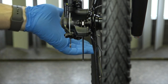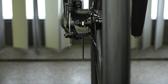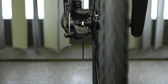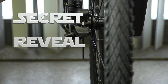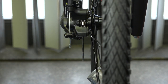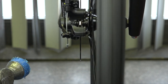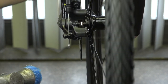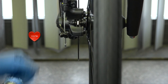So what if you don't have a 5mm Allen key and the disc still rubs? Well in this particular case, the disc is rubbing just very little. So what you do is find the area with the most pressure. Once it's found, grab your next handy tool which everybody has — and that is the hammer. Go between the spokes and just give it a love tap. Hold it down, give it a test. A lot better than before. Find that other area, once it's found point it out, test it out, and you're good to go.